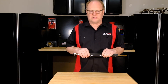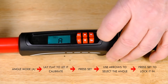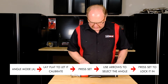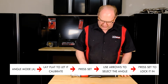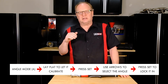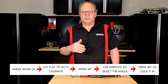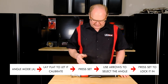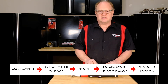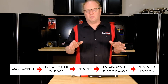To set angle mode, you select the A and go through your modes — there's your A, you select that, hit set and it puts it in. Now you have to have it on a flat surface like this and zeros will come across the screen. In this set mode it is calibrating when it does that. The last angle value will be displayed once you're ready to set a different value. Then you press set again and use your arrow buttons to set which angle degrees you would like, then hit set once again to lock it in.